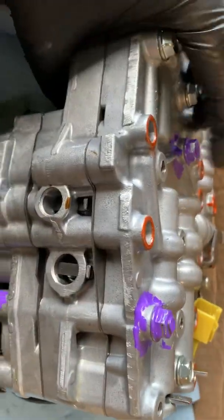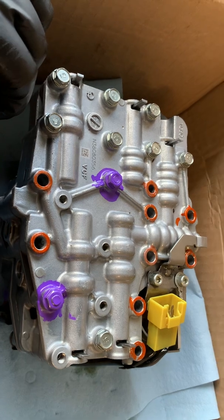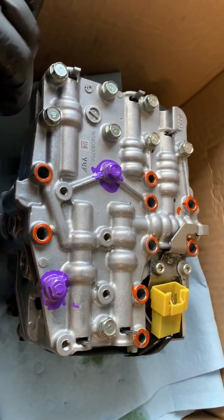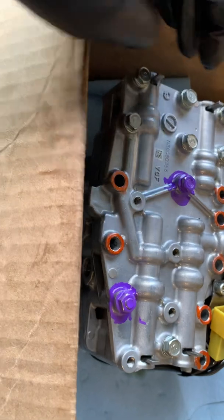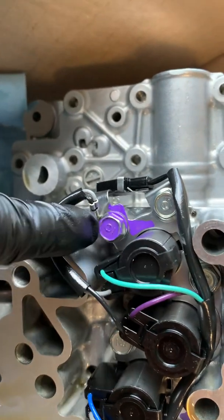As you can see, there's the nut and there's the nut. I wouldn't recommend marking it if you are going to reuse this and put it back in your car. This valve body is not going back in my car though — this is salvage for solenoids. So this is a good demonstration valve body. This one here you can kind of tell it's going through to the other side — it's got the nut here, second row, third one to the right, and it goes through to this edge over here to the left of the torque converter lockup solenoid.